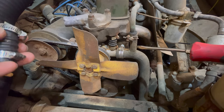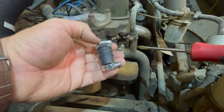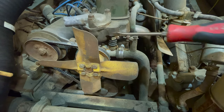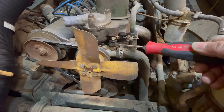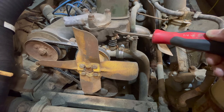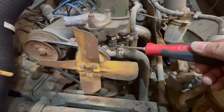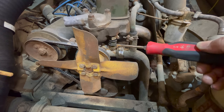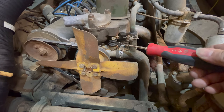I did a lot of thinking about which type of hose I should put in here — should I put one of these in like it's supposed to be, or just take a piece of straight hose, stick it in there, and call it done? I've decided that I'm going to do it right, and I have a new accordion hose here with two new hose clamps. This is by far the easiest to install, especially if you're not going to remove the head. If you have the head off and you put this hose on when you bolt the head down, it makes it really easy. Putting a straight hose in at that point might make a lot of sense, but for the purposes of this video, I'm going to do it right and replace it with another hose like this one.